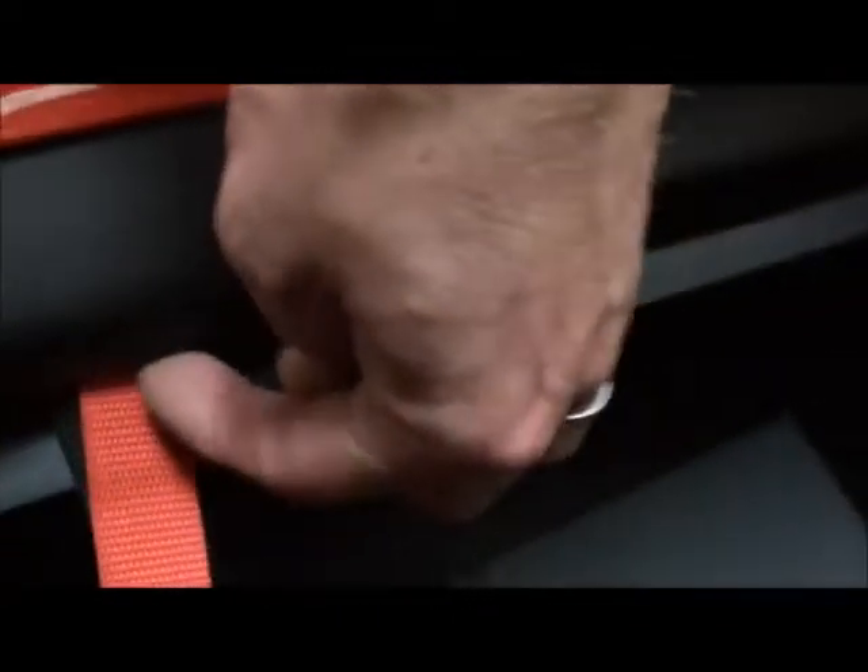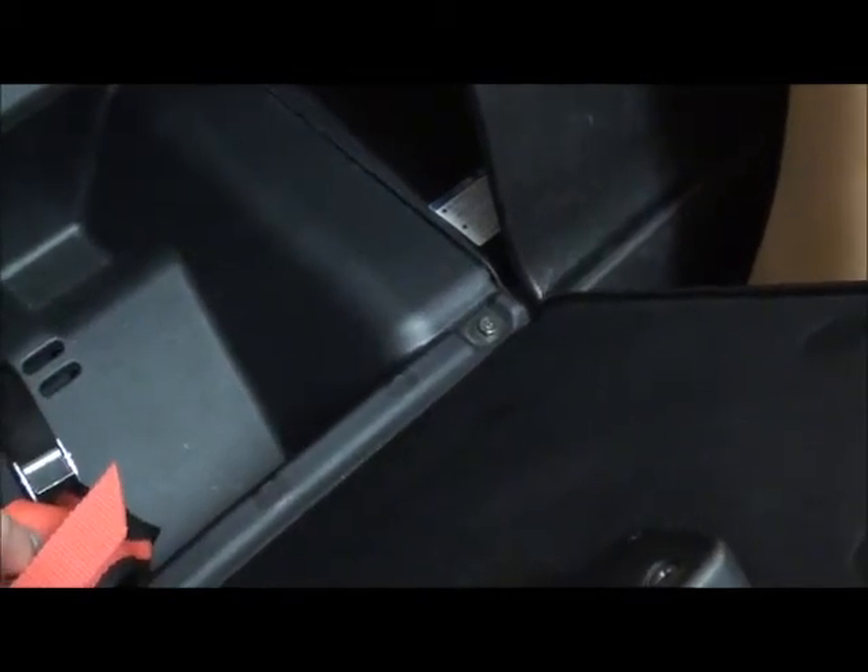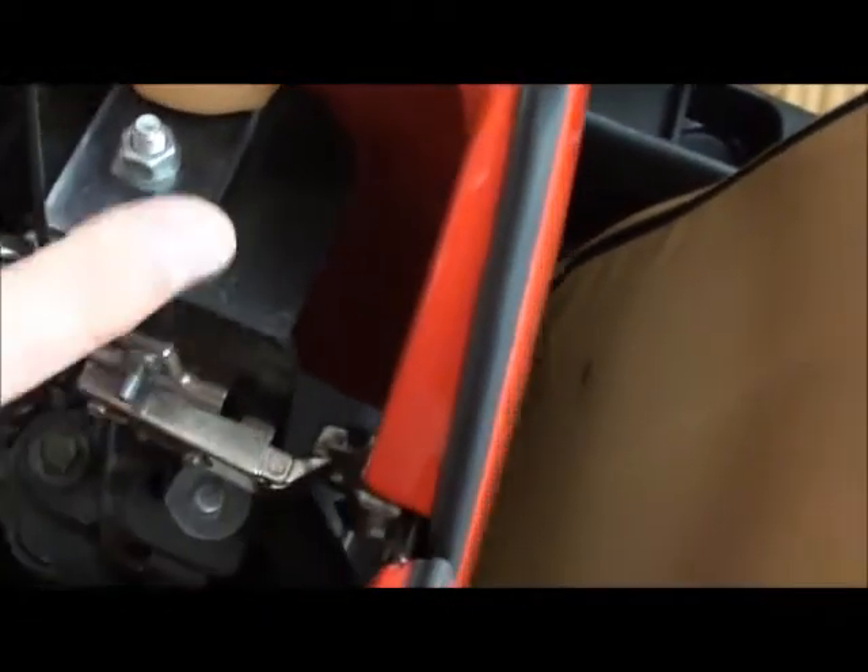You'll need to drill a slot in the roll bar cover to let those straps through — a slot about an inch wide. There are my two straps, and the roof straps just bolt to that bolt like that. I've got two straps on each side: one for the rear deck and one for the rear window. On your roll bar cover, these bits bolt to the bracket, but in order to get to them you need to drill a hole here on each side. You also need to drill a hole in the middle because there's a lever under there that secures your roof down — if you haven't got the hole there you can't release it.